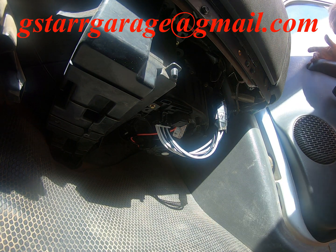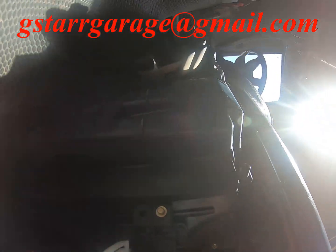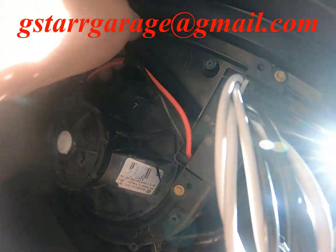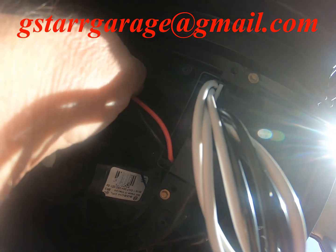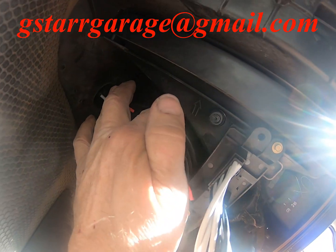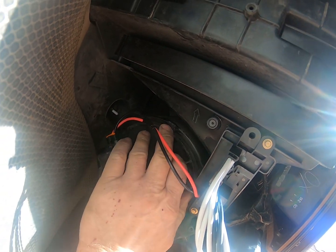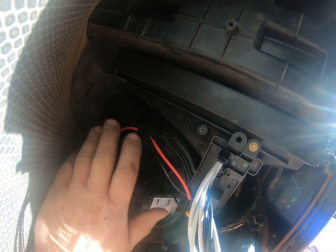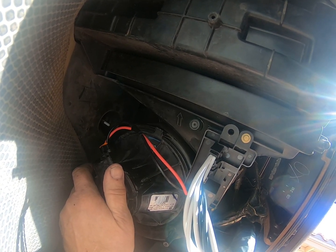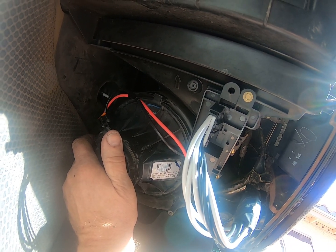Now, one thing I just want to show you, if I can do it, let me grab the camera. Whoops, sorry about that. Up here, that is the catch. I don't know if you're going to see this. That's the catch you need to push where my finger is, right there. You push that, and then you just twist the motor, and the whole thing drops out in your hand. It's a good design. Well done, car designers.